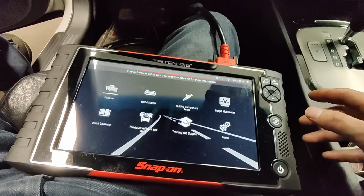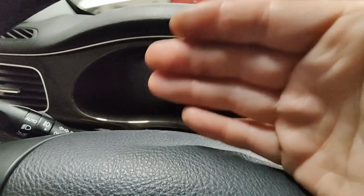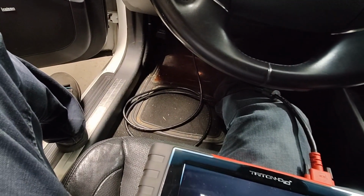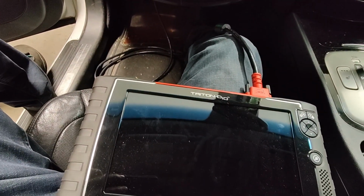So yeah, telltale sign. And also, if you're cranking it and you're not showing any RPM, because it should kind of jump up and down when you're cranking, and if it doesn't show that, that's also a good tell that you've got a bad crank sensor. So yeah, that's about it. And hopefully this thing doesn't stall out in there again.